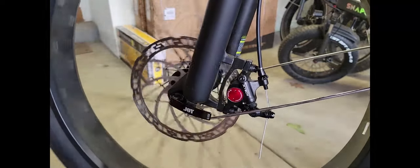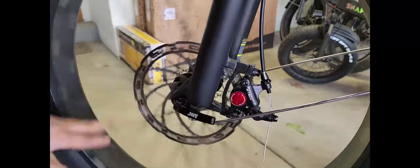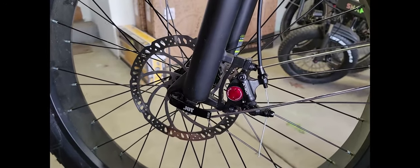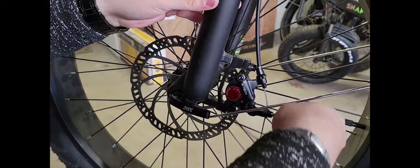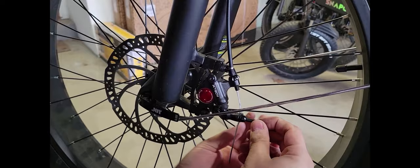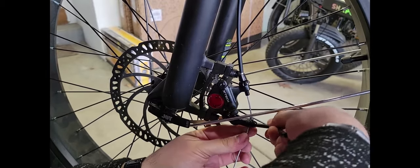Give it a good spin — no rubbing — then hit the brake. Stopping pretty good. Now I remember my mechanical brakes were really tightened all the way at the top, so I've adjusted it back to its default so it's really loose. Now we're gonna go back down to the bottom and readjust it so it's a bit tighter.